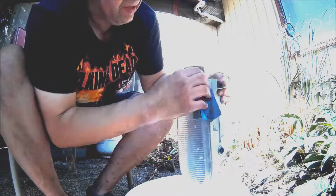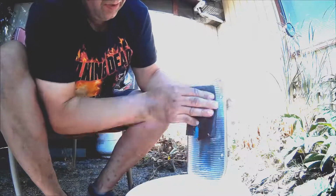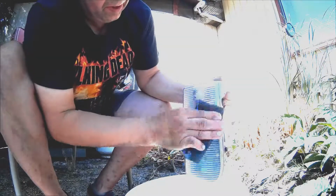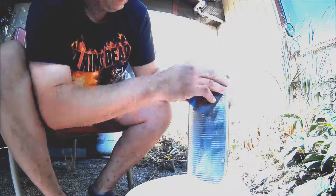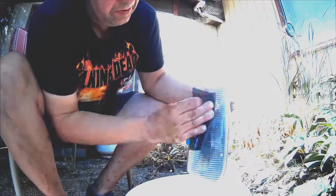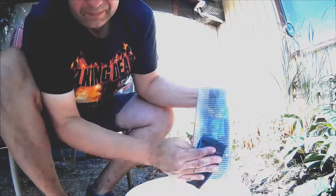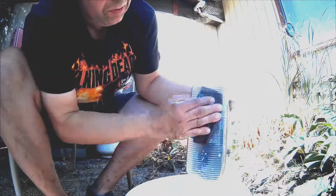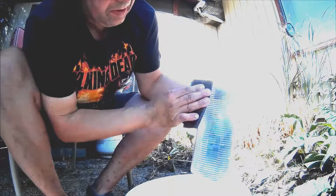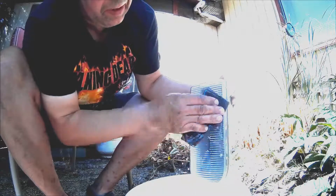This gets rid of the UV damage, and it gives a UV resistant surface to protect the polycarbonate again. That's the clear coat that I'm using, an interior exterior with some resistance to UV damage. I'm sure that it will go to hell eventually. Everything does, but I have some that are years old and they're still looking not too bad.